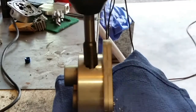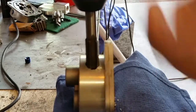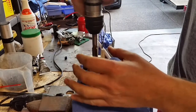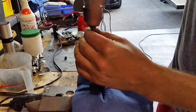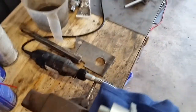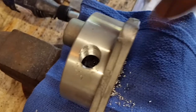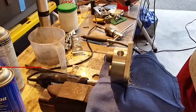That got pretty much all the way down. Remember, the end of your tap is tapered, so you do have to go down a little bit further than you think, because if you just go to the tip of the tap it might not allow you to thread the plug all the way down. When you pull the tap out, you're going to get some burrs at the top that you might need to sand off or take a file to. You can see the threads in there — pretty soft aluminum, but there are some rough spots in here that I'm going to try to clean up.